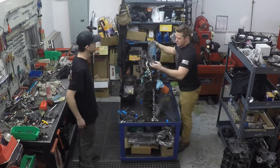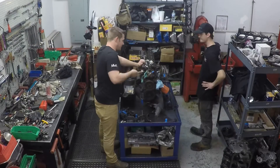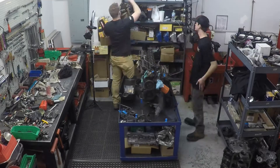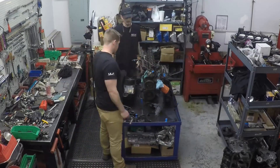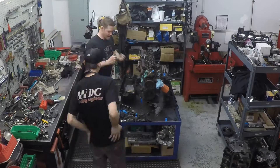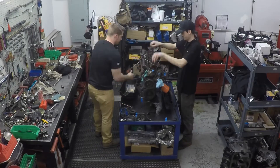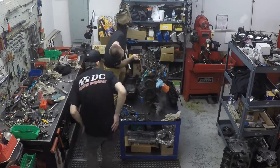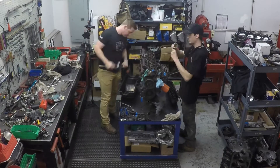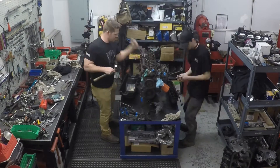Once we got the oil pan off we flipped the motor back over, took off the valve cover, and then proceeded to take off the head. To take off the head, the first thing you need to do is remove the valve train. Before we did that, we did some cursory inspections — making sure everything was still well lubricated, everything was moving freely, there weren't any areas of particularly bad wear — and we took pictures so we could retrace our steps later. We got the valve train off and then took out the push rods, making sure to keep them in the exact order they came out of the engine, since push rods develop particular wear patterns and we wanted to identify which cylinder any badly worn ones were associated with.